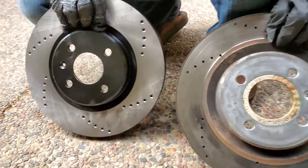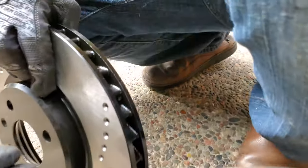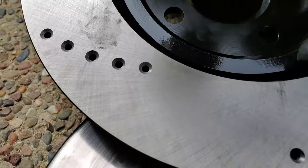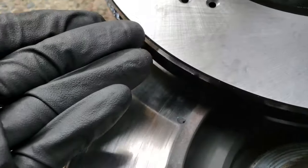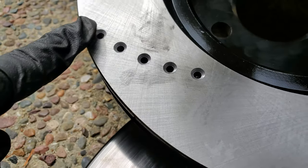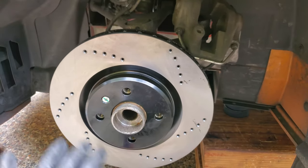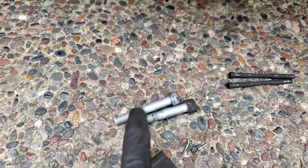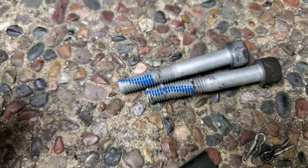Here's a quick comparison between the old and new. You can obviously see how much the rotor surface has been chewed away on the old one and how clean the new ones look — they're both just the same drilled design without slots, but that's fine. Another thing we noticed: see the little chamfer on the drill holes on the new rotor? That's almost a wear marker, because on the old ones they're completely gone — just a straight-edged hole. If your brake discs look like that and they should originally have this chamfer, it's definitely time to replace them. Before everything goes together, give your rotor a really good clean with brake cleaner — no oils or dirt before they touch the new pads. And for the caliper bolts, if they didn't have Loctite on them before, do put some on — we're using a little bit of blue on the threads.